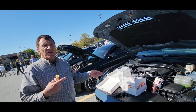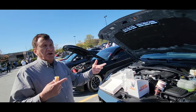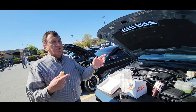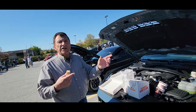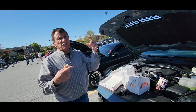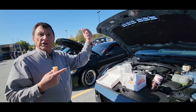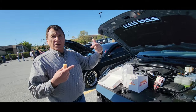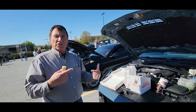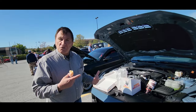I've got the older, not the really good manual transmission, so I put the rear transmission mods on mine. And then I got the adjustable front and rear sway bars. Then I put the poly vertical links on the rear. That sucker hangs and turns. The rear end does not move at all.